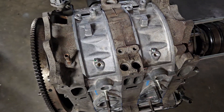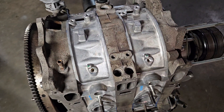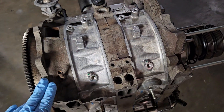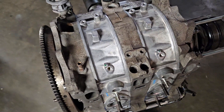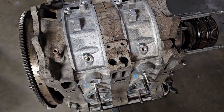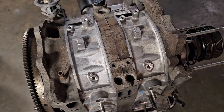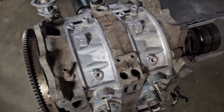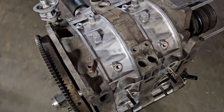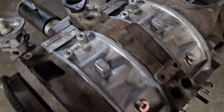This was a kind of interesting one because the motor is definitely going to get some abuse, but it's essentially desired to be OEM configuration. There's a little bit of just tech talk on what we've learned at KMR and how to build different styles of motors for different desired combinations. Kind of neat to see how you can utilize an OEM FD3S block — still going to make some power, single turbo, aftermarket computer — and just a single upgrade to apex seals to add more protection and reliability in that extreme environment. That's a wrap. Comment below, let us know what you think. A nice, simple, increased reliability FD3S block 13B. Thanks for watching. KMR.